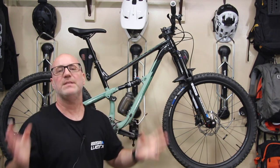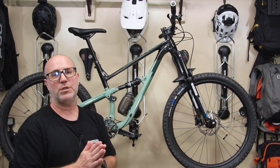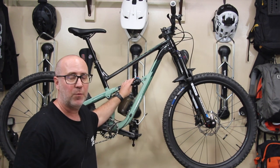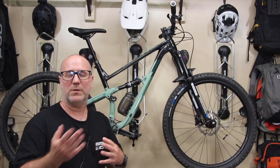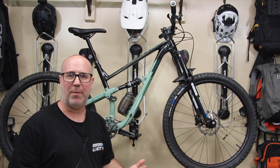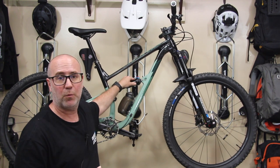First things first, let's take the easiest of those upgrades. I did put an SR Suntour Edge shock on this bike. Full disclosure - I've got a very good relationship right now with SR Suntour; they're a big supporter of this channel and they make very good products. This shock is on here partly because I want to support them, but I do feel it's a better quality shock than came on the bike. I also like the fact that this shock allows me to put a volume spacer inside of it, which has helped me tune the bike a little bit. I didn't change the stock shock because it was bad - this one just is better and gives me a little more room for adjustability.